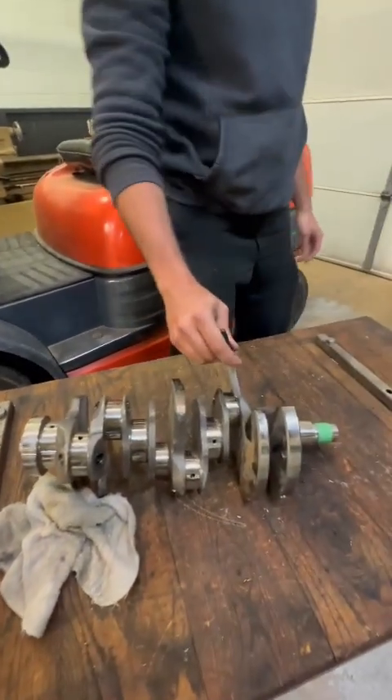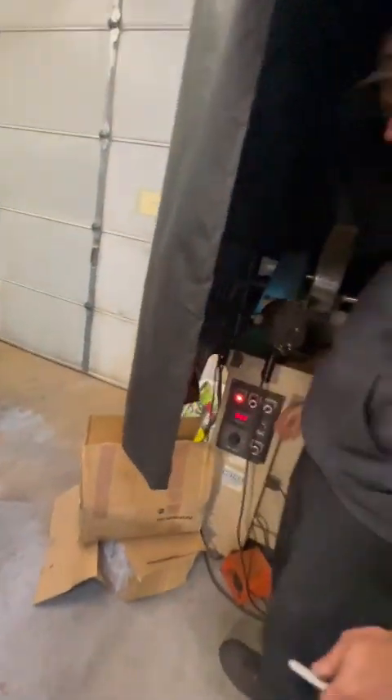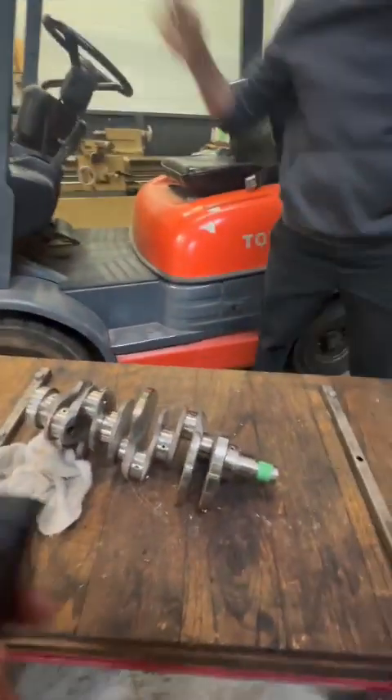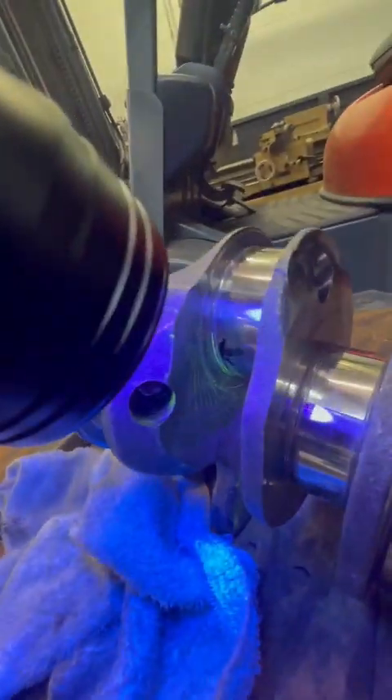It's also doing it up the front in the exact same spots, and we have another crankshaft in here. So we have a little bit different lighting here, and it's got another arrow drawn. Magnaflux allows us to make apparent micro cracks or cracks in crankshafts that may not be visible with the naked eye, or even under magnification. The goal of Magnaflux is to highlight areas where there are cracks.